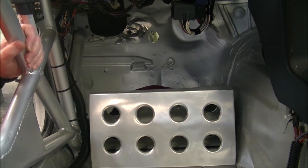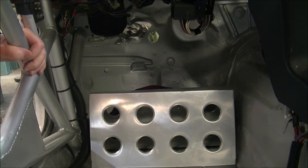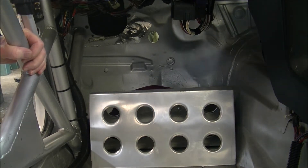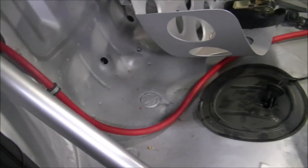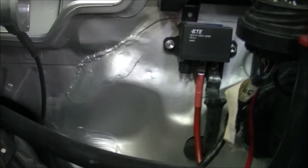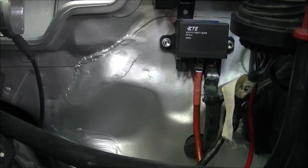So it's going to be the hole for the main battery cable penetration. This is the main battery cable being installed — we're using the original BMW cable that came with the car. It's going through the front there and that comes around to the electronic kill switch, which will be wired up to a switch on the dashboard.